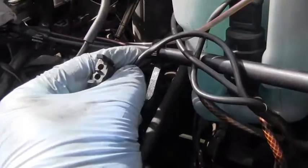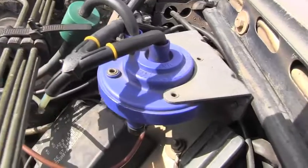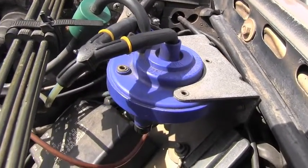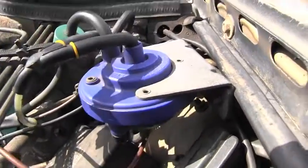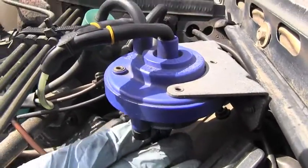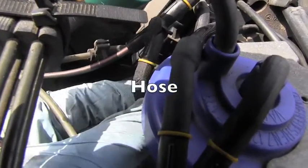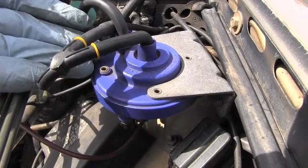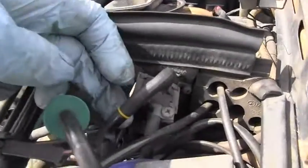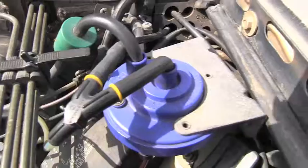Here is some hanging wire connector just freely hanging. Looking here at that transmission modulator valve — somebody sometimes calls it a flying saucer — everything appears hooked correctly and the hose is leaving underneath, so everything seems cool, right? Well of course it's not. Look at this valve: completely broken, ripped apart, there is a hole in it. So how can this vacuum amplifier and the vacuum amplifier switchover valve work when the hose is ripped and fully open?